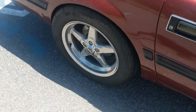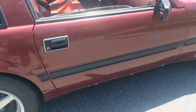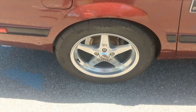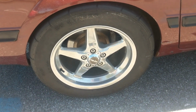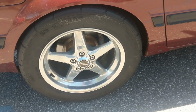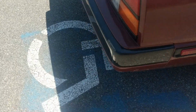Alright, moving to the back here. Those wheels up there are 350Z, 18 by 8.5 wide. They're the rear wheels off a 350Z from 2006. These are Race Stars. They're 17-inch wheels, 9.5 wide. It's like 7-inch back spacing because the S14 subframe's so wide. Needed a lot of back spacing. They're Mickey Thompson drag radials on there. They hook pretty well. They're 295/45R17s. I don't even think they make these anymore. Now they have the 305 tires. Yeah, the car's a little dirty.